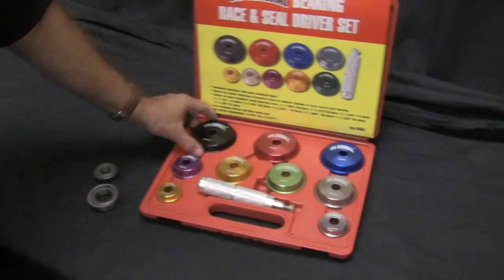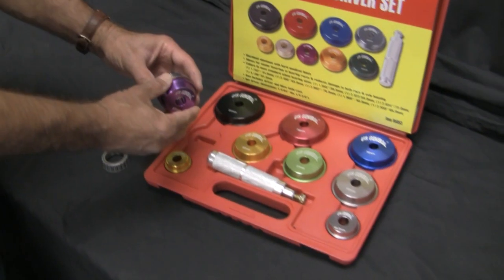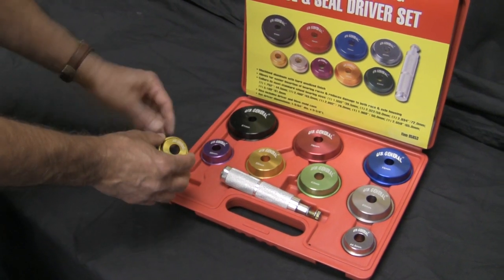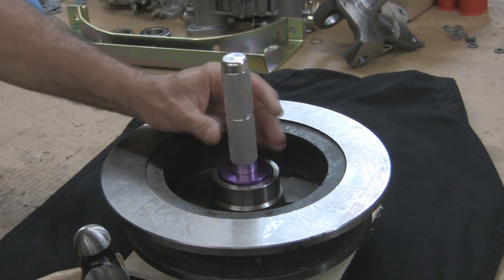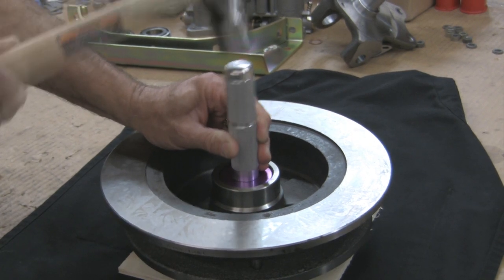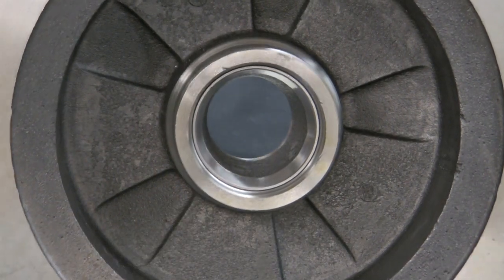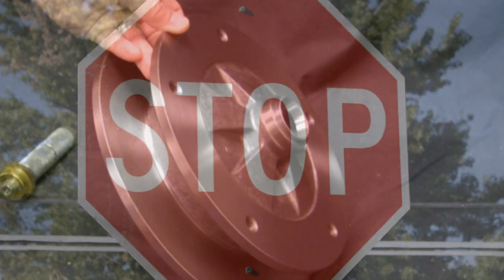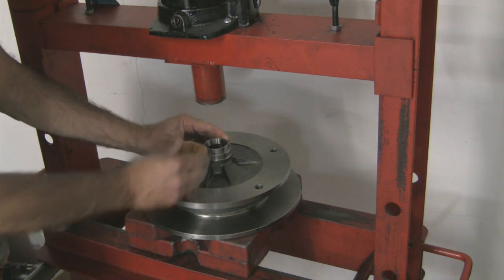The first thing that you will need to do is install the bearing races in the new rotors. Service manuals explain that this requires a hydraulic press, and that is our recommendation as well. The cost of a pro installing them with a press is much less than having to replace even one of the rotors. But if you want to install them yourself, bearing and seal installation tools are available for as little as $30. Be certain that the race has started straight in the hub, place the appropriate size tool on the race and tap it in, and be sure to check after each couple of blows to make sure it is going in straight. If it is not straight, stop — do not continue to hammer it in. Rather, remove it and start again, or better yet, take it to a pro for a press installation.